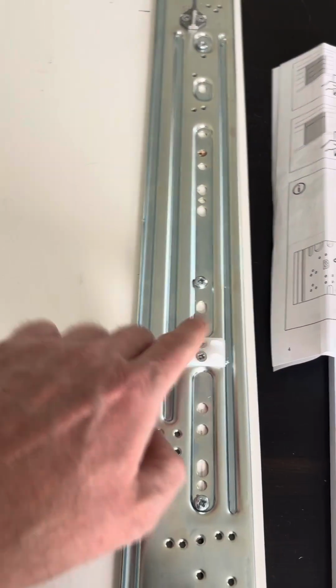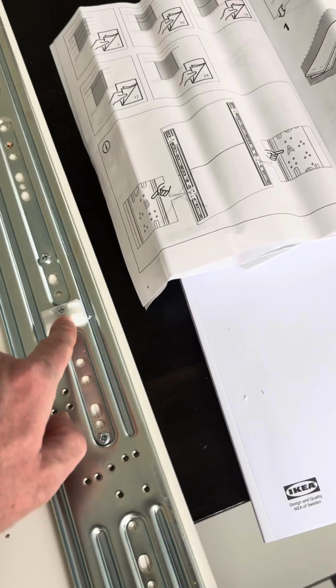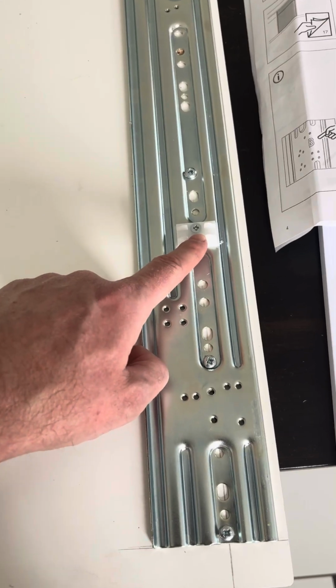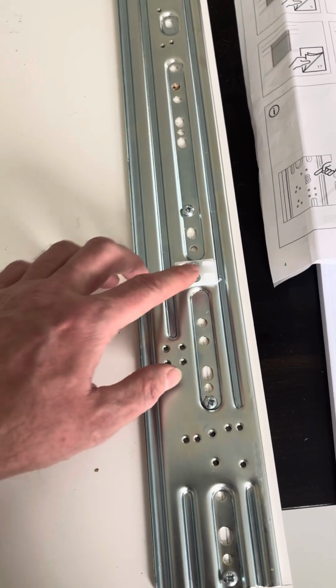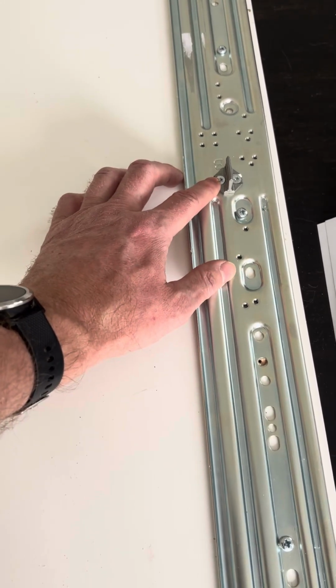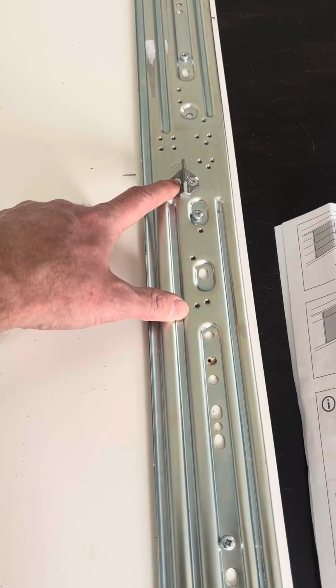Back this out, you'll need a screwdriver of this type. Get that in focus, one of these hex heads, star shaped or whatever they are. And then you have to put the 2 plastic ones at the top, here and here. These are actually machine screws, and you can see from, it'll tell you further on that they're machine screws. I didn't notice that there were any cut threads in the holes, but you do need to be careful that you come in exactly vertically and get those in. And then these ones were self-tappers that screw in themselves, so I just used a knife to scrape away some of this harder outside part, and then they went in pretty easily.